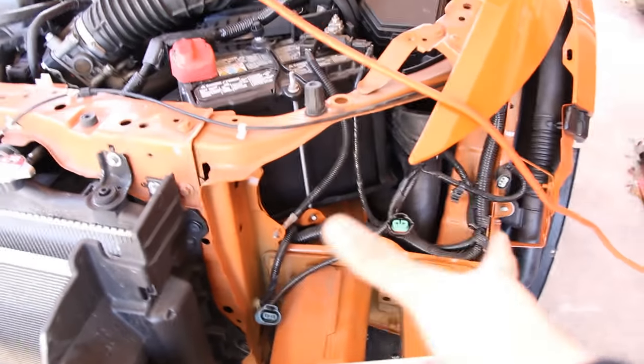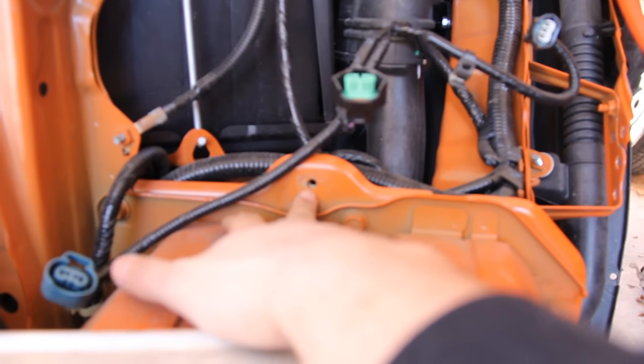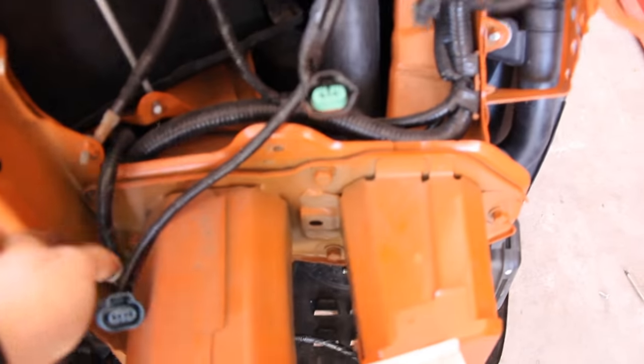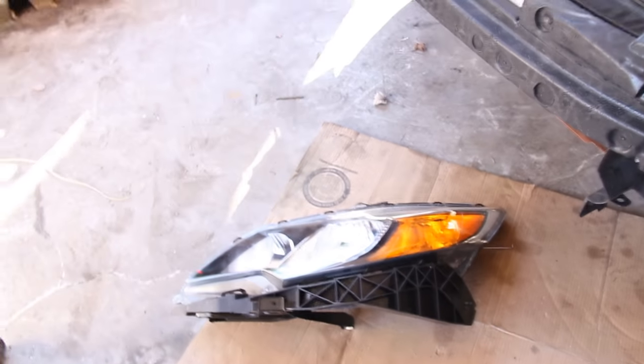To take off the Civic headlight on a coupe, you take this bolt off — it's a 10mm. Then you need an extension because it's really tight in here, and it's another 10mm here. There's also a third bolt, 10mm, located right next to the Phillips head that holds the bumper onto the fender. Then you lift up and it slides out. Make sure you take off the connectors because you can break them, so be very careful when pulling the headlight out. Now that we've got the headlight out, let's get the install ready.